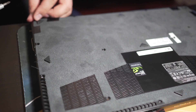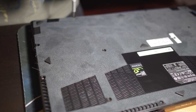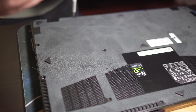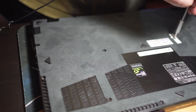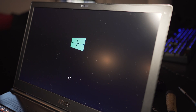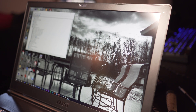As long as the ethernet is not broken, I could live without Wi-Fi until I get a replacement cable for those mini coax cables that I may have broken. I'm not sure if I broke the cables themselves — I broke the old network card's connector clips and they came right off. So be very careful while taking them out if you're doing this — I didn't know they were that fragile. Let's boot into Windows and go to Device Manager. There's an unknown network controller, so I should have probably downloaded the network drivers beforehand.